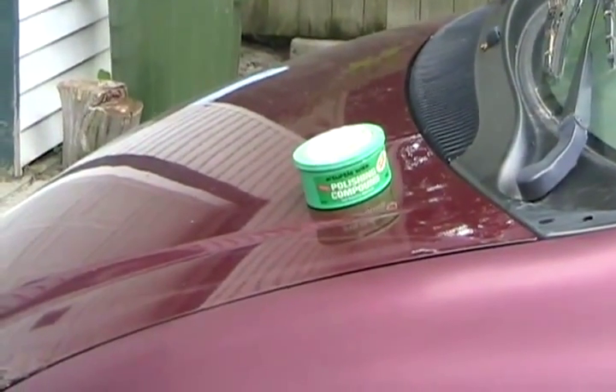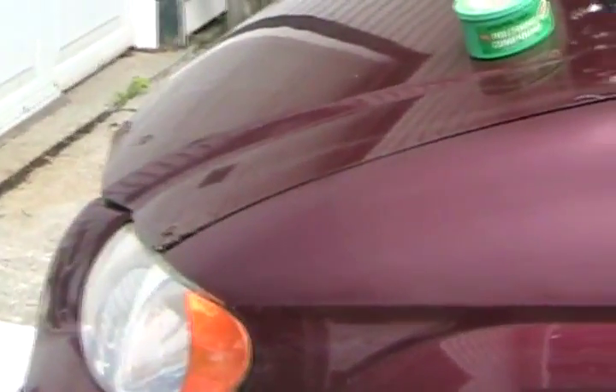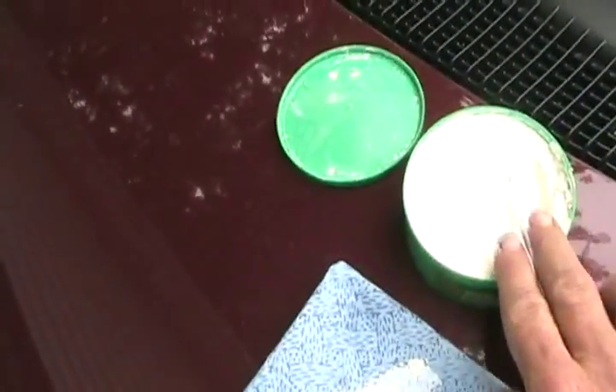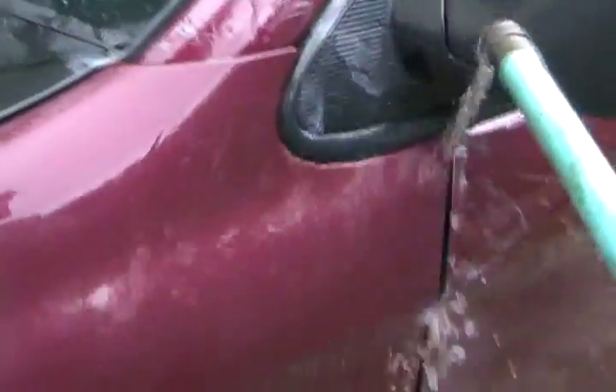I just use a cotton cloth or similar rag, dampen it, squeeze most of the water out, put a blob of compound on it, and rub hard and even all over in mostly circular motions. Pressing very hard, and preferably do this under a shade tree. This stuff dries out too fast if you do it in the sun, so always choose a garage or shady area. This stuff looks, feels, and smells like wax, but it's not wax. So when you're done polishing it sufficiently, you actually have to wash it off before you go to the wax process. After rubbing and pressing hard for ten minutes, it's time to wash it, rubbing it with a wet cloth too.